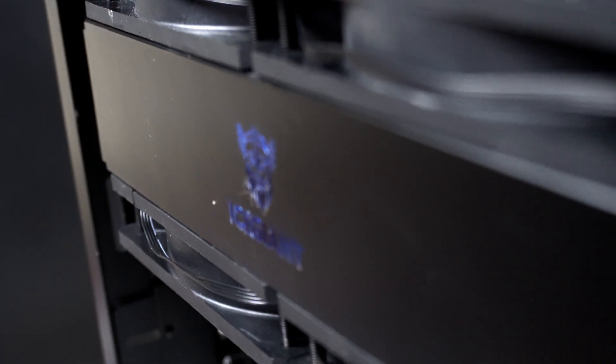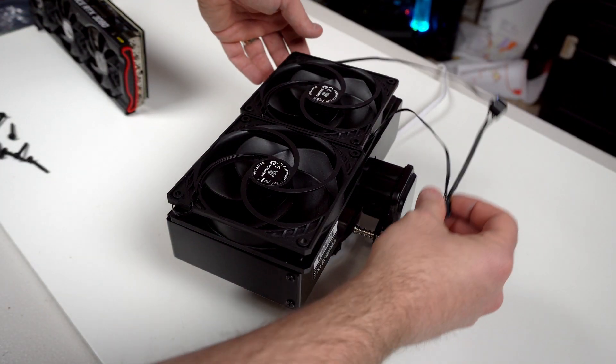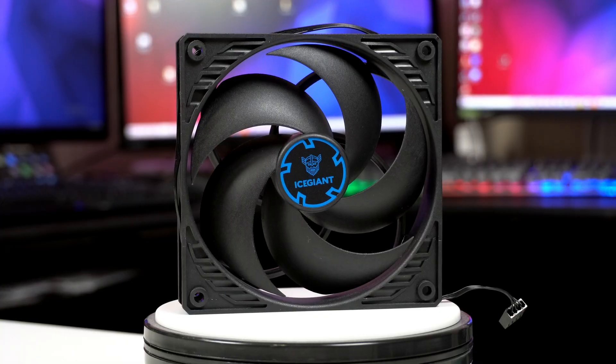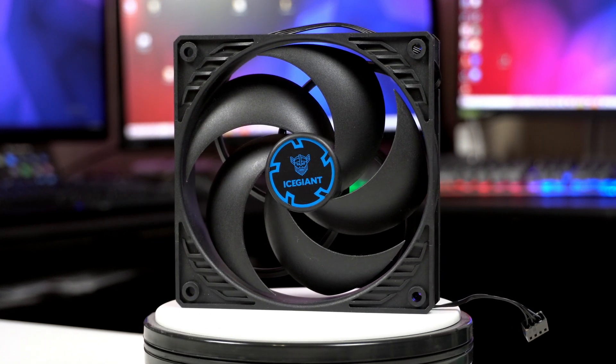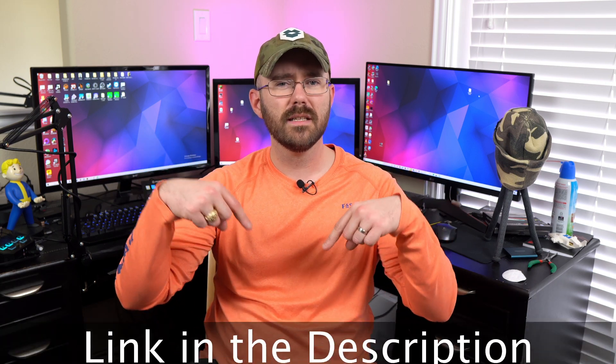Given the unit's form factor, one must have a chassis that not only can house the beast, but also potentially have enough room for two additional fans towards the top to improve airflow through your system. Cable management can also be a hassle, though creativity and preparation can be a good workaround. IceGiant includes all of the mounting hardware for all of today's common sockets, including AMD's AM4 and TRX, and Intel's desktop sockets. Also included are four Arctic P12 PST fans with additional fan splitters, rated for 2300 RPM — a sizable increase over standard off-the-shelf P12 fans.